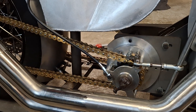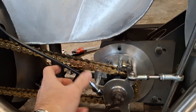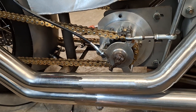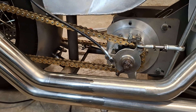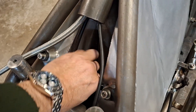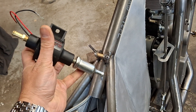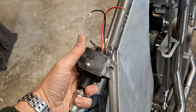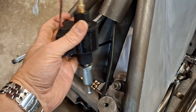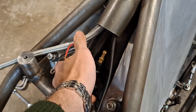When they arrive, I'll wire everything away from the bike and test it before I fit it all in nice and neatly. I also need to make some kind of carrier here to carry the batteries, and make a choice as to whether I have to remove the tank to get the batteries out from the top, or whether I'm going to lean the bike over and come up from the bottom. I've also taken the seat off because part of the wiring involves the fuel pump. The fuel pump I've purchased is quite a length — it's got this inbuilt changeable filter, which filters the fuel before it goes into the pump, which is a jolly good idea. I might even put a filter on the outlet side before it goes up into the carb, but there isn't an awful lot of room for that.